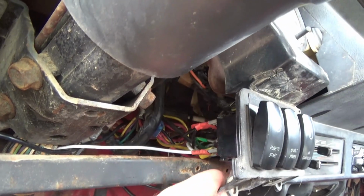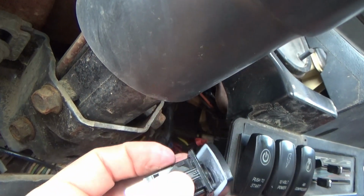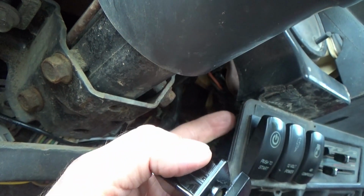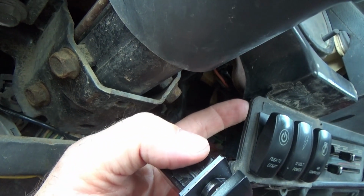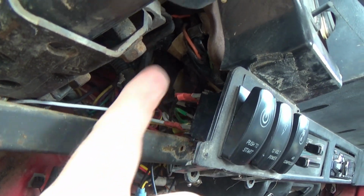As you can see, removing those screws gave me a little bit more wiggle room to get my fingers back up inside there. And what we've got to do is, see how those little wings right here? You push down on those wings on each side and you pop the switch out. Now pop the top side out, push these bottom wings in, which pops the bottom side of the switch out, then you work them out from there.